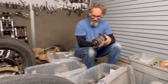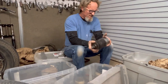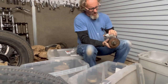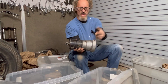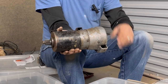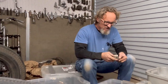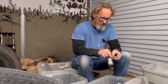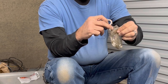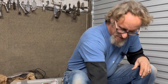Now we're into the generator box. I'm assuming these are all six volt but I'll have to check. Here's one generator — it's even got a data tag. Here's another — Harley Davidson, made in USA, stock six-volt generator. Here's a third one. This piece on the end of the generator is actually a fan that circulates air and cools the generator. The municipalities put these on police bikes because they rode them almost 24 hours a day — it kept the generator from overheating. There's also bearings in here — bearing races with the little bearings inside. I probably have 500 of those from Eastern Parts new old stock.